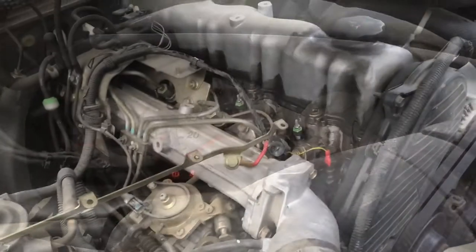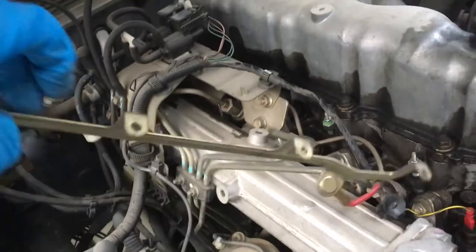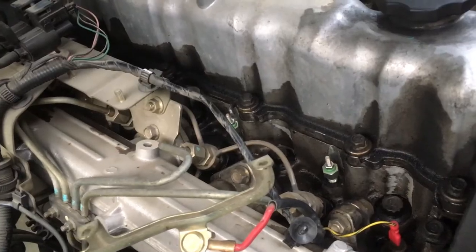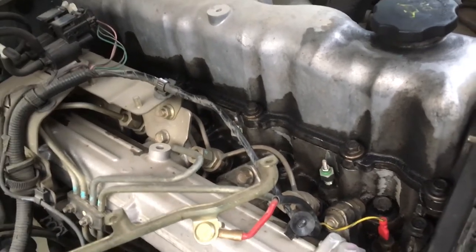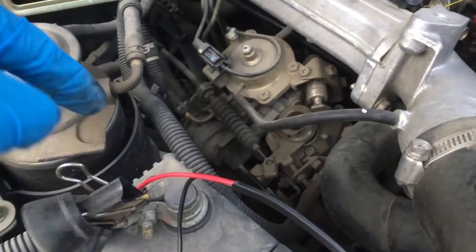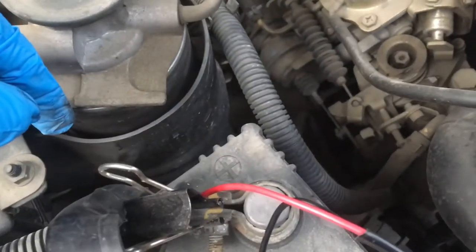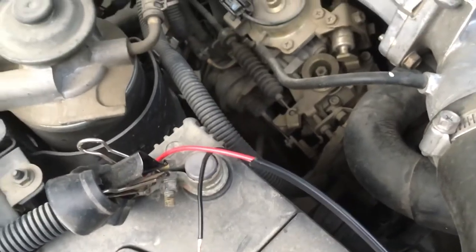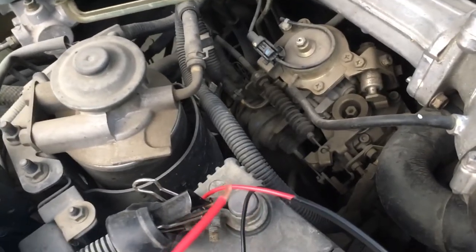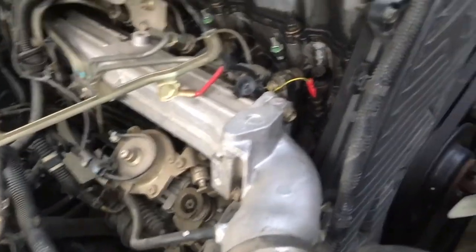Now that I've got it going and running much smoother, let's jump under the bonnet and see how we can test these real quick. All we've done here is removed the rail that connects the four glow plugs together, because we want to be able to test them individually. Then all we need is a random piece of wire. I've got a bulldog clip holding the end of the wire to the positive terminal on the battery. Obviously need to be careful where the other end is — you can hold it on with your hand; I'm using the bulldog clip because I have to hold the camera.